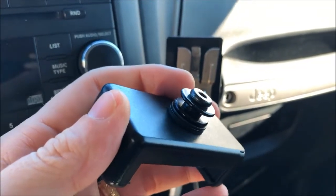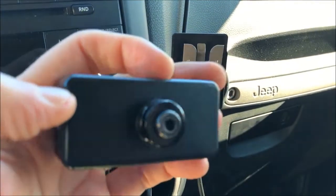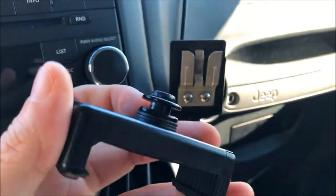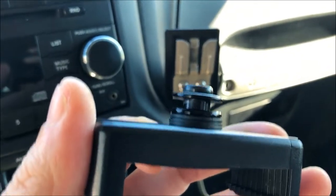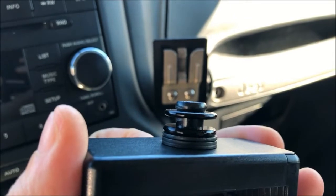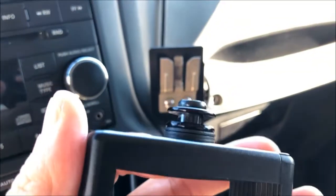Links are in the description below for both the phone holder and the CB button I picked. It's just got a quarter-20 fastener in the back. I had to drill out the hole in the CB button a little bit so the fastener would fit through it. There are some washers in there because I had to get the spacing just right — I was cheap and lazy and didn't go to Home Depot or Lowe's to get exactly the right fastener, so I needed spacers so it wouldn't bottom out on the inside of the phone holder.